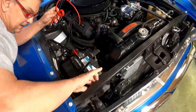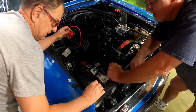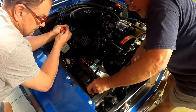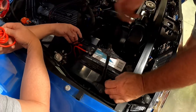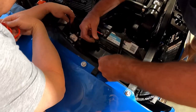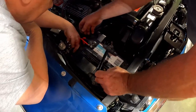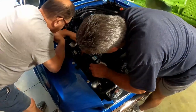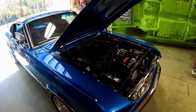And that's probably this here. So even though you do a one-wire alternator, you still need to run the wires that need ground. They still need to run back to the battery. Yeah, so this isn't disregarded. Oh, too bad it doesn't reach over and plug into that. What if you undid this? Where's that hooking up? To these two. All right, okay. We'll revisit some wires here and come back, and a ground. All right, we'll pretend that this is the first time that we've tried to start it.